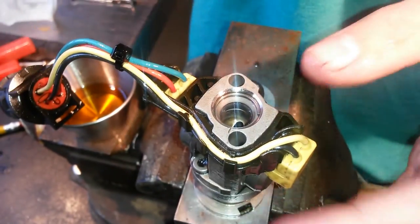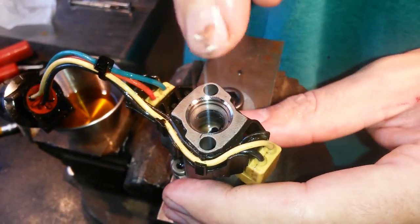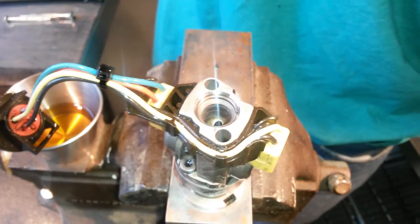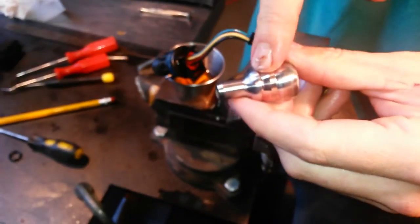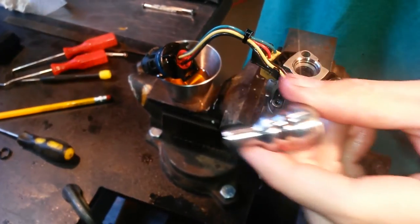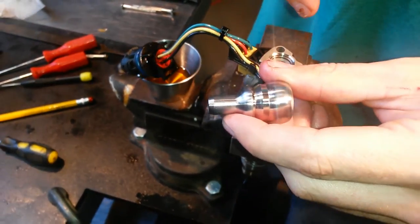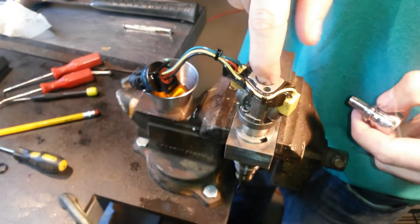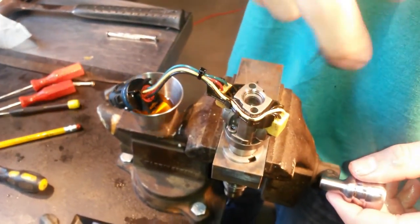Just make sure you use plenty of oil — that oil not only helps to work its way in there, but it also helps with the final sealing process. It helps the seal seat when the oil system is pressurized for the first time. If you're going to replace your nipple cups, make sure you use HHC Diesel Bulletproof Nipple Cups and HHC Diesel Top Seals and Nipple Cup Seals. Stay tuned for the third video in the series, where we're actually going to show you how to take that C-clip out and do a full replacement outside of the vehicle.